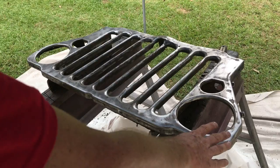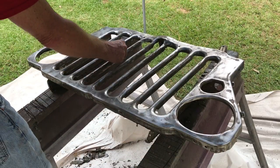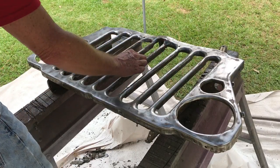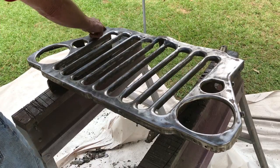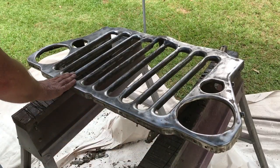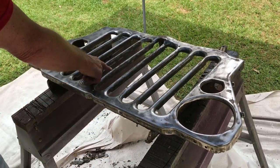So I've got the front side pretty much done, and I found a couple of things. This particular slat rail right here has got a wicked twist in it — this one's got a wicked twist in it too. This corner, as I showed you when we first started, it's pretty beat up and banged up, but we'll probably be able to dolly that out. I've got a dent here. You can see that wire wheel's got it pretty much cleaned up to bare metal, and I'm going to have to go back and do some handwork, but I will do that after we fix these things.